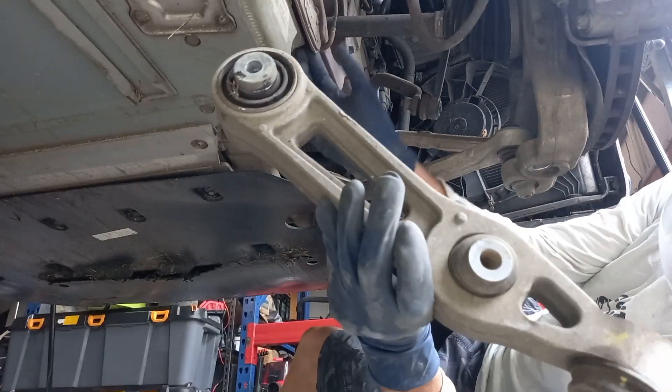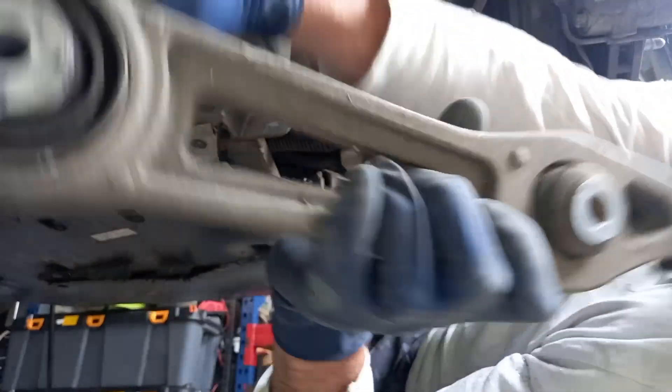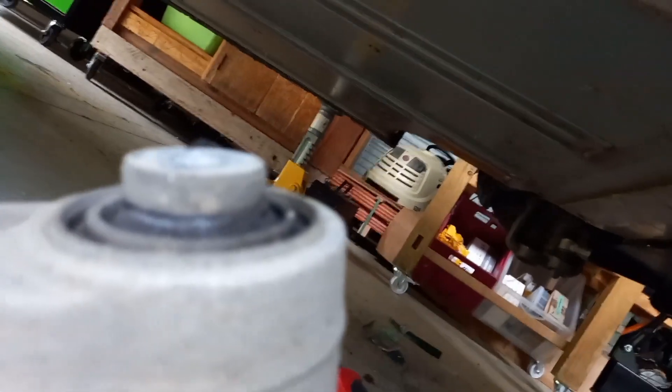Just for your information, I was cutting through the actual sleeve here. As you can see, I cut through the sleeve, so I was cutting a lot more metal than I needed to, but that's fairly soft. I chose to do that because that way the saw is definitely pinched against something sacrificial — you don't want the saw bouncing around, but you don't want it in something you care about. That sleeve is exactly the right thing. Turns out I had plenty of room near the bolt head.